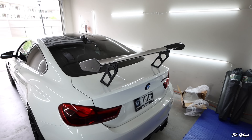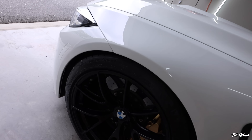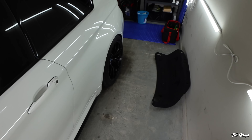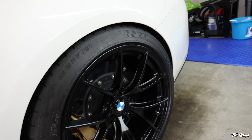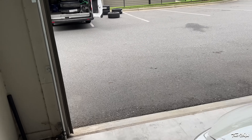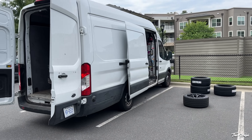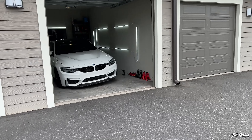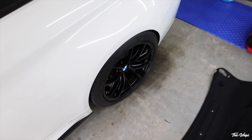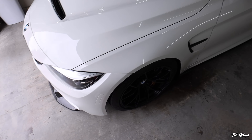This actually turned out really good — I think this looks a lot better. I'm going to throw back in all of the stuff for the trunk. Some other things I ended up picking up for the trip was some new tires. Not that my Cup 2s were worn at all — they were pretty much brand new — but I got another set of Super Sports really only for the ride up to the Keys Auto Show because there is a little bit of rain in the forecast. If you know Sport Cup 2s, you do not want to be caught in the rain on them because it's like ice skating. So I picked up some Super Sports just to play it safe. It's 275/35/19 front, 305/35/19 rear.